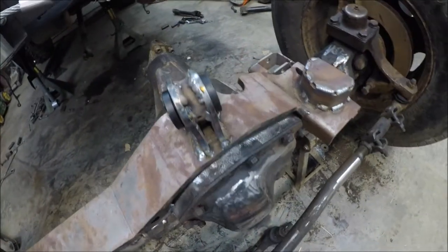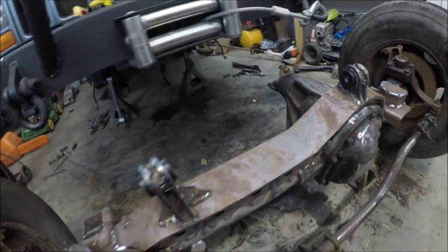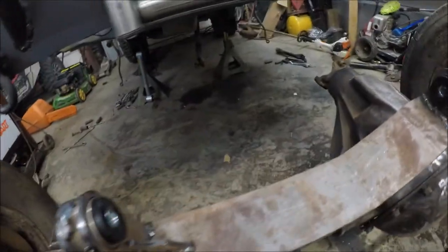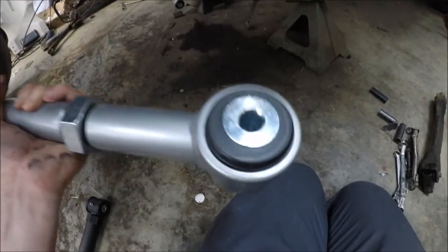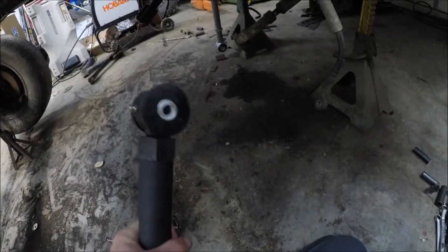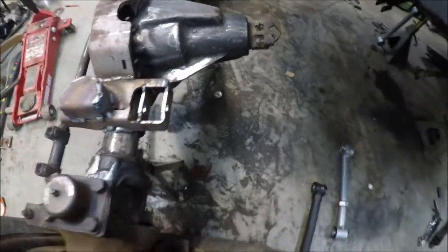The instructions say to put the lower control arm mounts as far out on the axle as you can go. My lower control arms were fixed ones — they didn't have any heim joints in them. So I went and purchased a set of adjustable lower control arms from Rubicon Express that have a heim joint in them, and I'm thinking that will allow it to move over enough so I can put them on the edge. I wanted the adjustable arms so I could adjust the angle of the axle the way I need it. I also went ahead and spent a little extra money and got adjustable upper control arms too, because the kit says these mounts are three inches higher than factory.